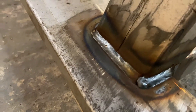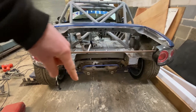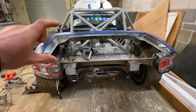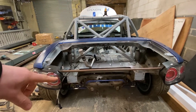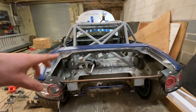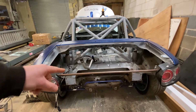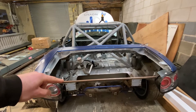I tacked both sides and once tacked I leaned it in the right direction, tacked the other side, and it should be square enough. I flipped it upside down to get the weld in there — considering what this is doing, I haven't gone for pretty welding, just get it in there and get it welded. Now I'm just about to start drawing up the mounting plate, which is going to rotate on the jig and mount the frame. There's a couple of things to account for: the 100mm height difference between the front and rear, and also the adjustability to find the center of gravity. With the roll cage up top and sub-frames, tank, gearbox, driveshafts, and engine all out, I reckon there's going to be more weight up top than at the bottom. We've got to make this plate large enough that we can offset the height from the ground and potentially the center of gravity.